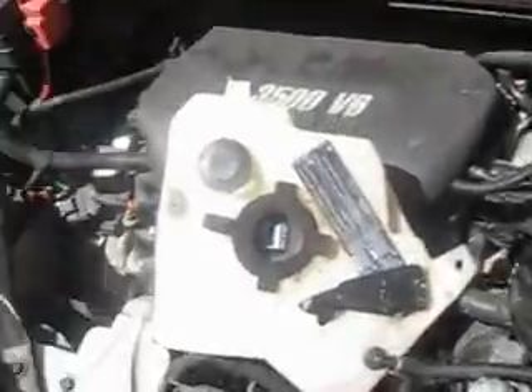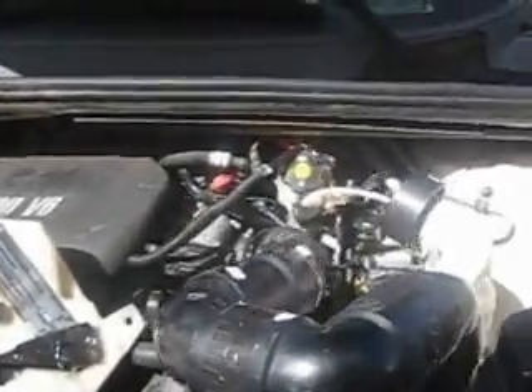Well, this is what we have. I have my air cleaner taken out. This is my vaporizer, the first one that I designed. I have my gas line going into here so I can let fuel in because I don't have a bubbler connected — it's not working right, I need to fix it. You can listen to this — it's almost doing no bubbling at all but yet it's running. I actually found that it runs better with less bubbles. You still need the same amount of holes but without as much gas it works better.